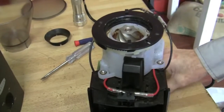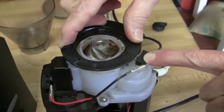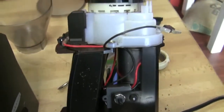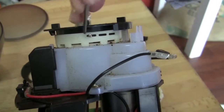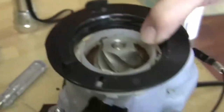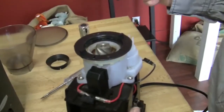This is the micro switch that, when you turn this adjustment ring, engages the switch so you can actually grind. When it's in this position, it will not grind. Down here, as you can see, there are three slots. With the screw in this side, this is the coarsest. We're going to move the ring — this ring in orientation to that ring — over to here, and that's the finest. In the diagram they show coarsest, neutral in the middle, and finest. The screw position varies due to manufacturing — they just randomly put in a screw and move on.